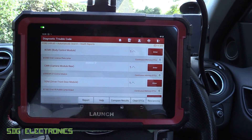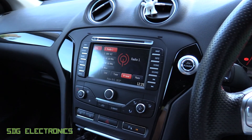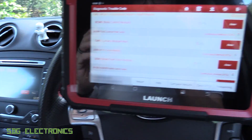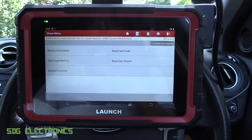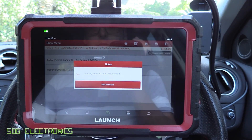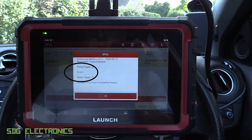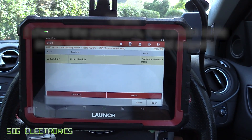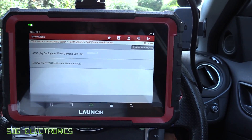All done - really nice and quick. Interestingly, we've got a fault code for the camera module, which has just started playing up again. Put it in reverse and we get nothing on the reversing screen - not even the flashing. It says we've got a fault code on the control module. Reading the fault code - it doesn't really give any information about it, just that there's a fault. I'll have to check the power and grounds again to that unit - perhaps one of the nuts I put on previously for the extra ground connection has come loose. The camera just stopped working the other day.